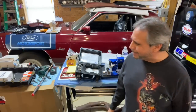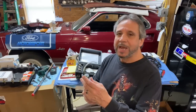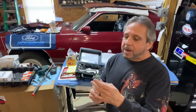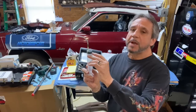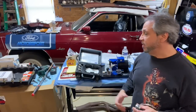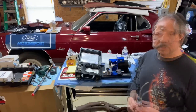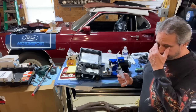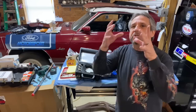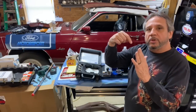Every cylinder looks perfect — I can't believe it — except for number two. Number two had some oil in it. I got my syringe and sucked it out. Looking at what I got on the rag, I probably pulled out about 3.5 to 4 cc's total. Where did it come from? It didn't come from the rings — I don't think — because it never smoked. I smelled it and it doesn't look burned, doesn't look like it went through the edge. It looks like it's leaking from above. Through the bore scope it almost looks like a drop hit the piston and pooled in the little oil trough on top.